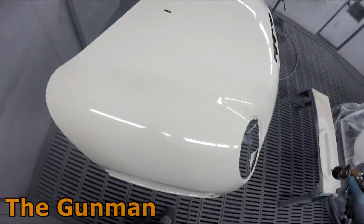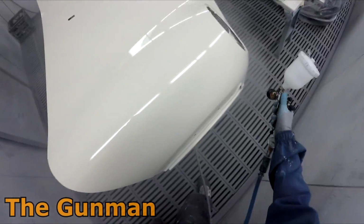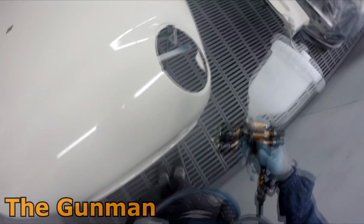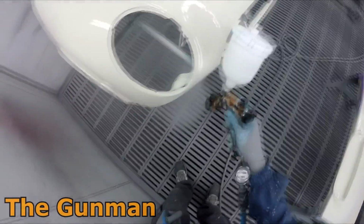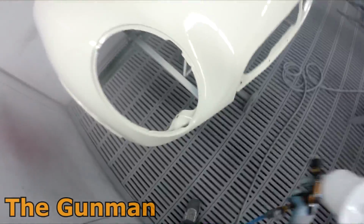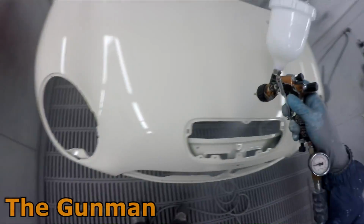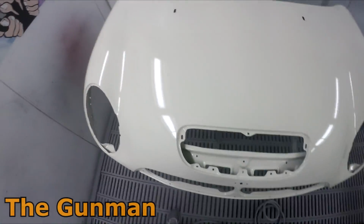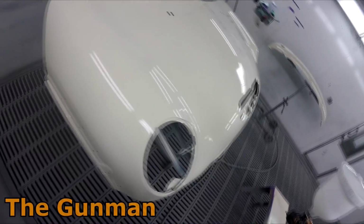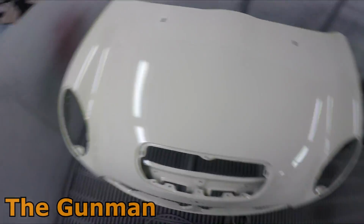You probably also noticed that I just did the flat out, straight up tack and whack method. So just put one coat of clear on and then straight up put a second coat of clear on. When I was first introduced to this method, I didn't have a tech rep or a paint rep come out and show me how to do it. What my tradesman sprayer at the time told me was that it is 30-70. Everyone was going around saying, oh, 30-70. So I thought 30 must be 30% of a coat, so I thought that 30 was not even a closed coat.